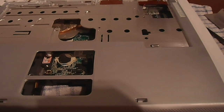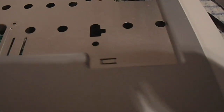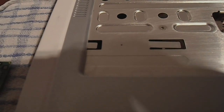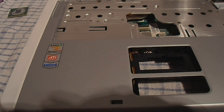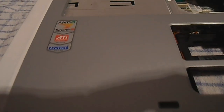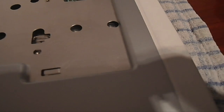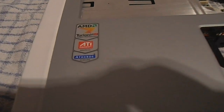Now that I've taken the lid off, I noticed there's some discolouration on the plastic, so I've decided to spray it. That will save me twenty-odd quid on a new one — there are no cracks in it, so I'm just going to go over it with some plastic coat and then two coats of clear on top. That's the lid resprayed — I think you'll agree that looks a lot better. I've put two coats of silver on and two coats of clear gloss enamel, and it's got a lovely shine to it now.